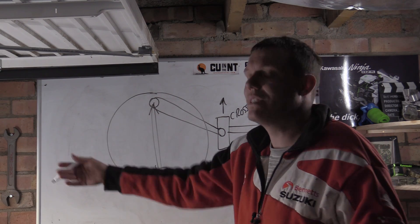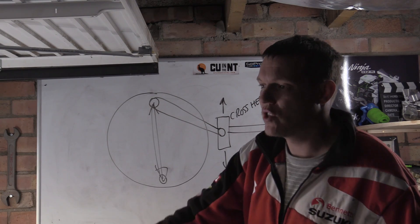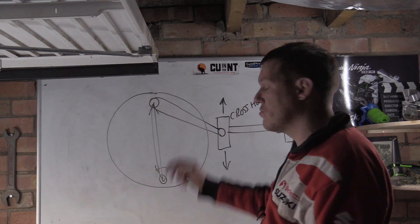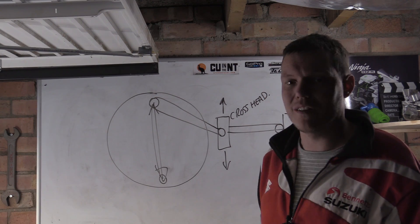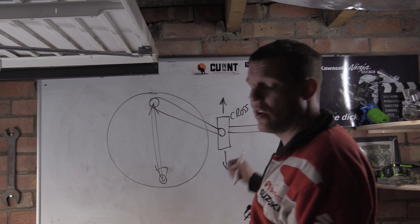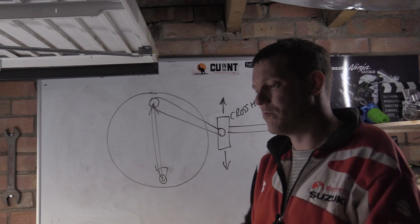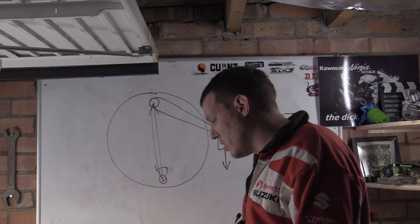What they do is basically have a secondary piston — it's a bearing — called a crosshead. That crosshead basically slides inside rails, like bushings, and then the piston itself just goes straight in a linear fashion, so you don't get all this friction and ovaling and stuff. With massive strokes like that, you're going to greatly increase your piston slap. Not only that, these engines are designed to go millions of miles — you don't want to be dry-docking a ship, tearing half the deck off, pulling an engine out that's the size of a building, taking it all apart, which takes about a year, just to stick another bearing on it. Instead they can just replace the crosshead bearings. These bearings are designed to take side loadings where your piston generally isn't, and you can replace the rails with a lot less effort. With trains, same kind of thing — this huge stroke with basically a short connecting rod — so to take out that lateral movement you have this crosshead bearing. It's easy to pop that out and put some new rails and bearings in than to mess around with your piston.